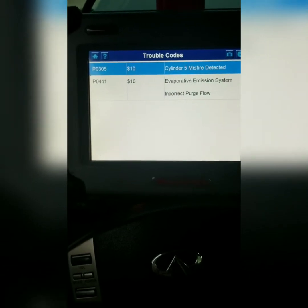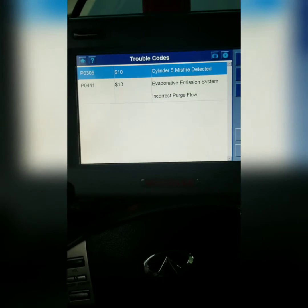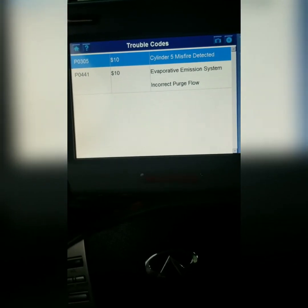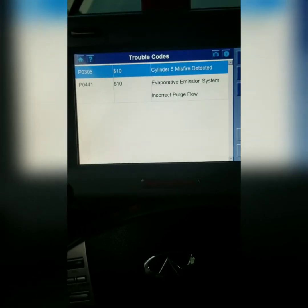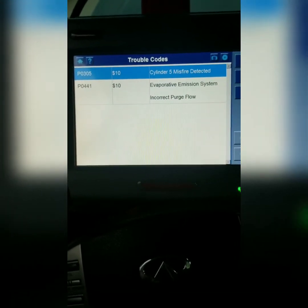I'm going to go in and record me changing out that coil pack. I'm going to change it over to a different cylinder, just to make sure that the misfire then moves and goes to cylinder number 1. So I'll see you guys in the engine bay.